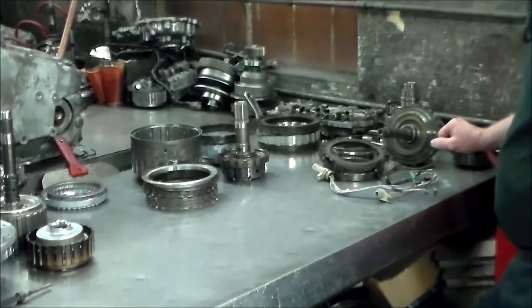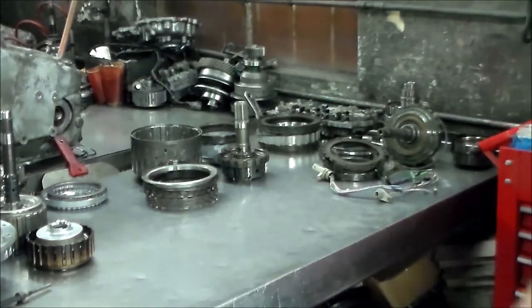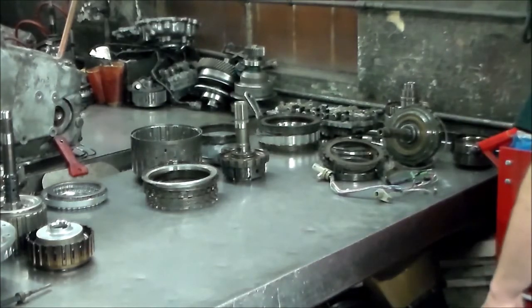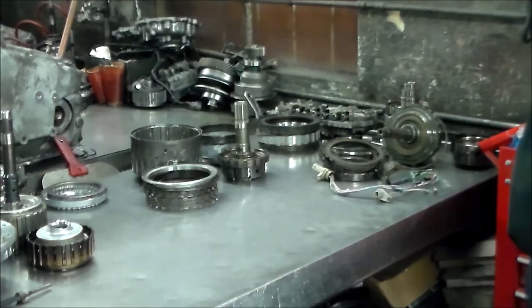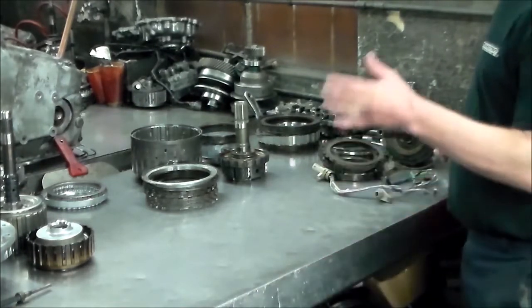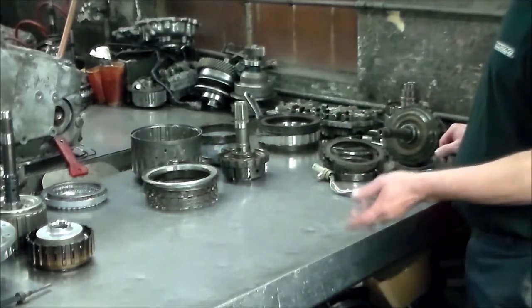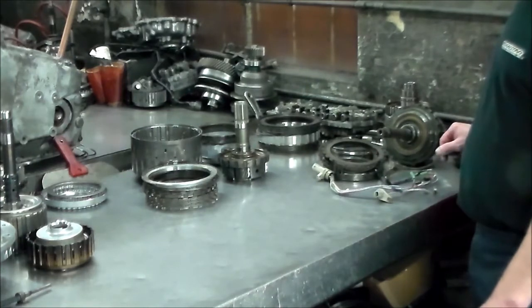Alright, so I guess that's about it on this 2007 Toyota Tundra with the AB60F transmission. And we found that the pump bushing, again, it's the second time I'm seeing this, welded to the converter neck. And from that, the fluid leaked out, and I guess they kept driving it, obviously, because they totally fried the C1 and the C4 frictions.